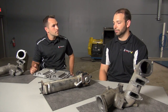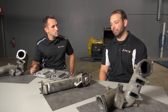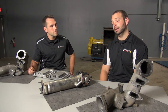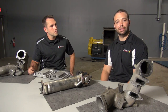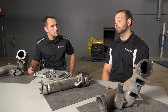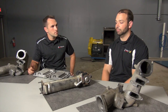They're very similar trucks. The emissions equipment is a bit of a frustration — the LMM is the first year for the DPF. The DPF system is not as capable as the emission system on the LML trucks, so they are a little more prone to failure. They don't have the ninth injector, so you have the potential for washing out the rings, getting extra diesel fuel in the oil. It requires maintenance.